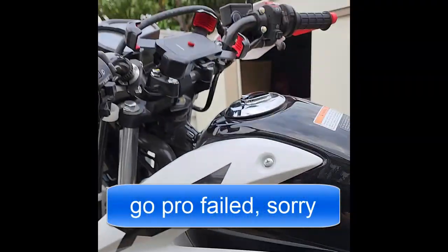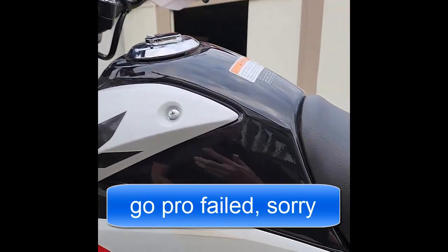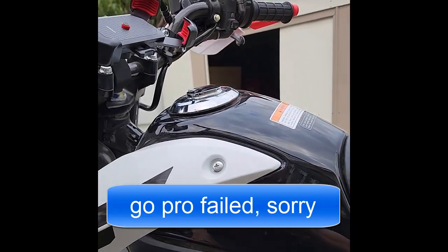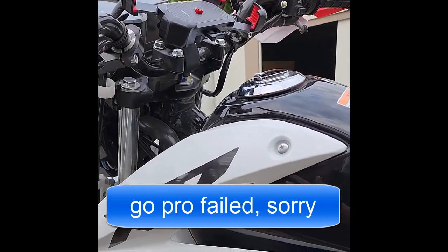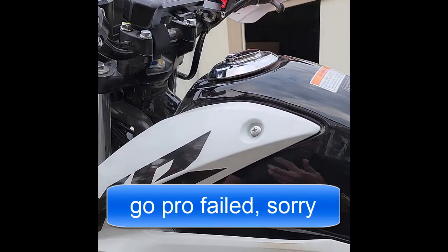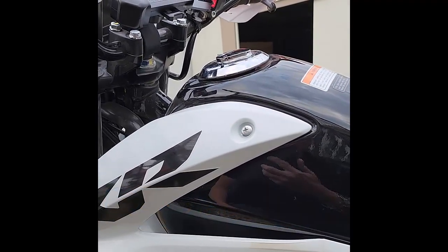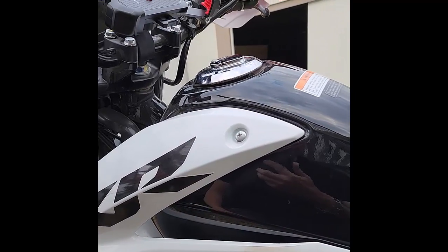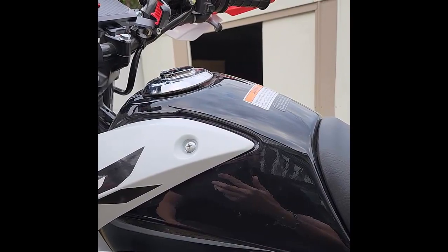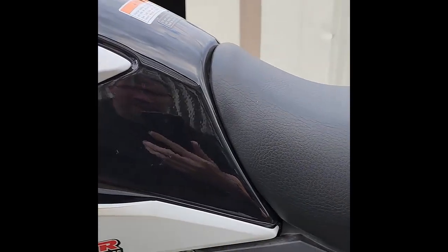As you can see I got a little bit more top speed with the jet change. It went from 98 kilometers an hour up to 102, 103, and on a downhill I was getting up to 108. But anything over 80 there's so little torque that a headwind or a slight upgrade just knocks the speed right down.